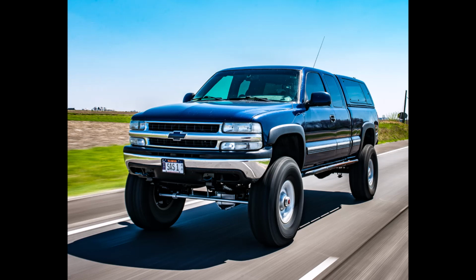The anti-wrap bar's done. It's stretched. It's 110 inch wheelbase. Cut the quarter panels. New springs up front. Packed the rusties out back. Bump stops, limit straps, new shocks. The list is endless. It's like, I didn't do that much, and then I start thinking about all the things that I've changed since the last time I went out. The only thing that's the same is the driver's seat. Yeah, you got a new rig, basically. Yeah, the driver's seat and the roof panel, from what it was.